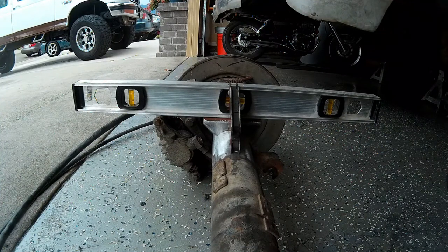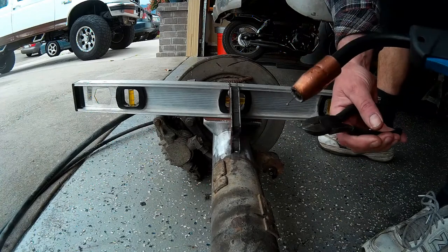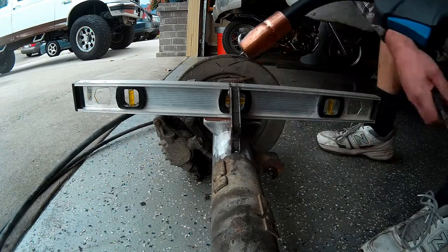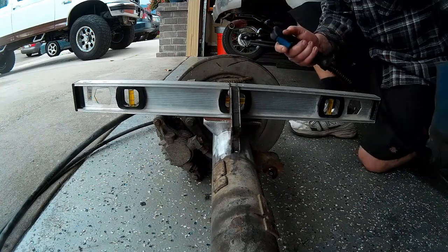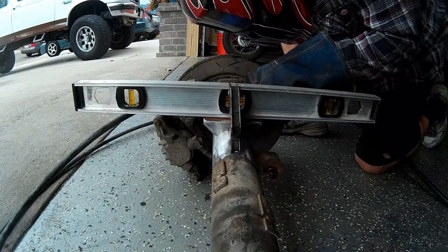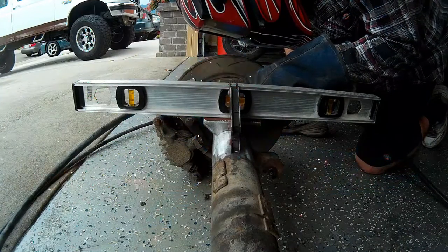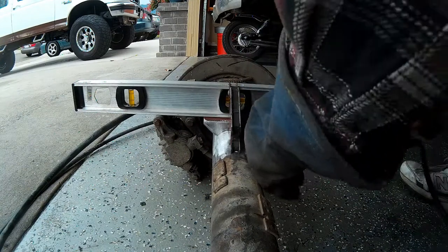Just a quick voiceover of what I've got here on screen — I've got my leaf spring perch set level relative to the axle, which is currently upside down, and the pinion itself is pointed up 3.5 degrees. I'm clipping off the end of my MIG wire here, which is always a good idea when you're going to tack or weld — keep the end of that wire clean. I'm going to tack these perches into place. I've leveled them so they're horizontal, checked them side to side for level, and checked them for square with the axle tube.